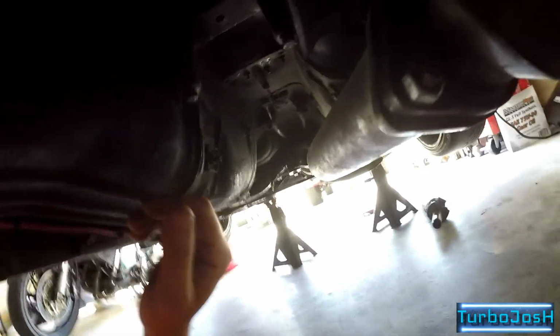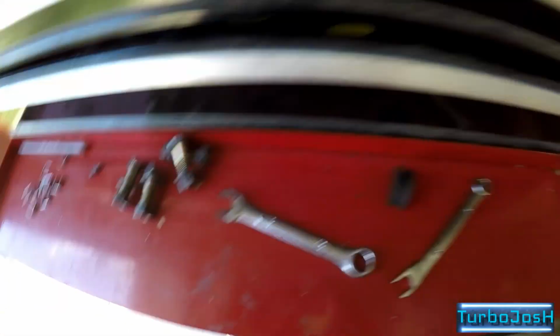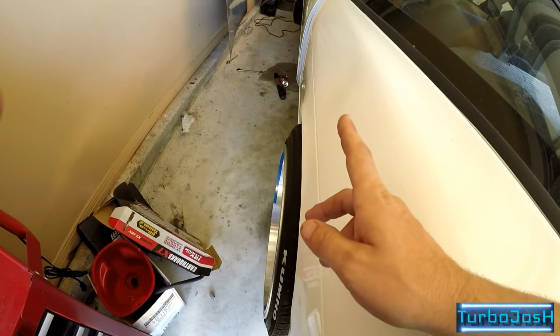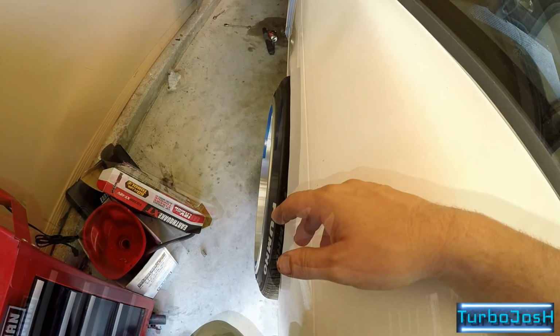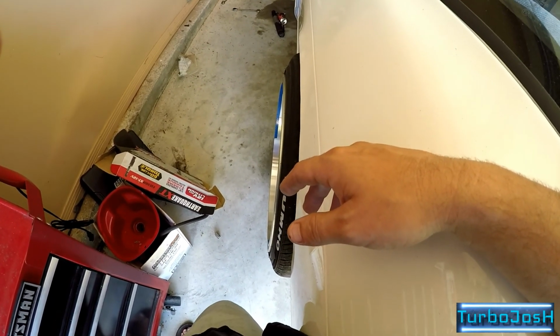In about an hour we'll have everything put back in, and we'll be ready to rock and roll. Drive shaft bolts left. Everything's pretty much done. I need to put these drive shaft bolts in. We need to put the starter in, which is 2 bolts, 2 wires for the starter. Make sure my bottom bolts and my turbos put back in, because I undid my downpipe to get the motor higher so that I could get the upper case off. I needed more room.